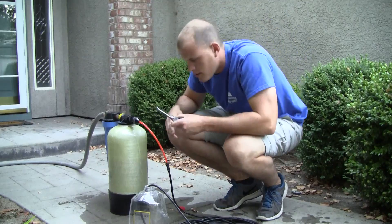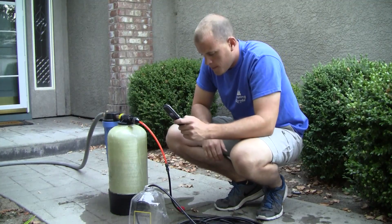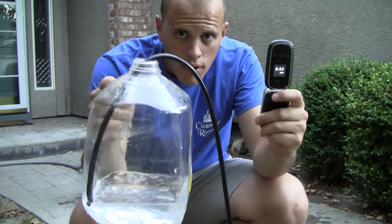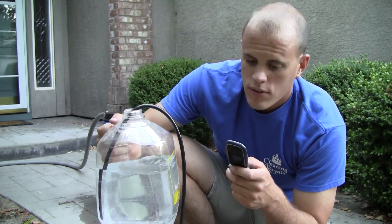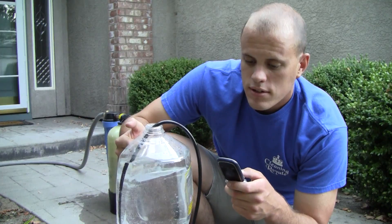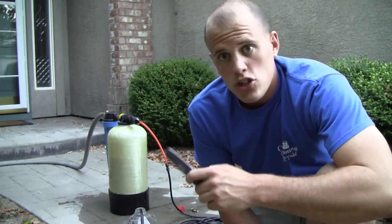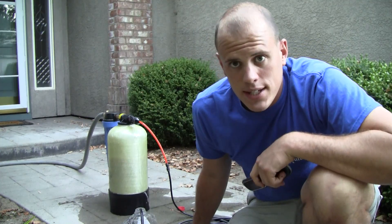Flip phones are always reliable. Alright, three, two, one. See it's filling up there. We're at 16 seconds... 30 seconds... 45... This is gonna be close to right at a gallon a minute. 55, 56, 57, 58, 59, 60 — almost a gallon a minute. And it overflows right at 1:05. So with the nozzle at halfway, it's about a little less than a gallon every minute. That's what you can expect from a 5/16 inch hose.